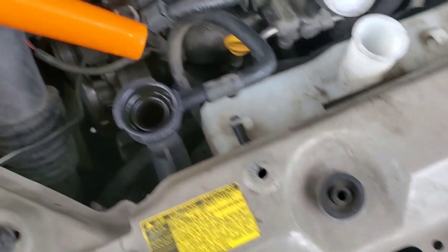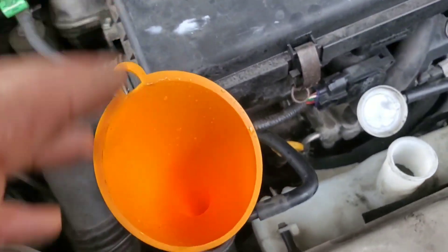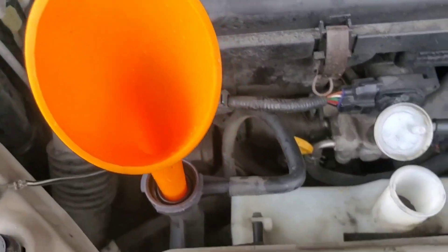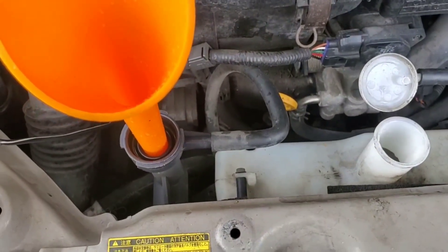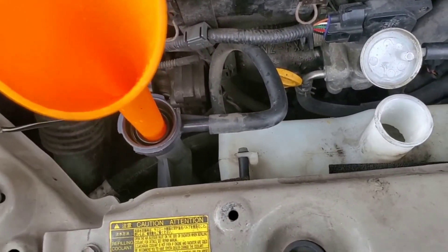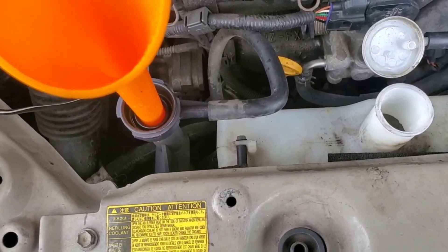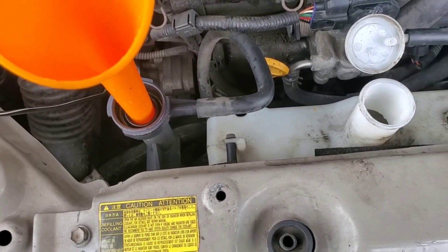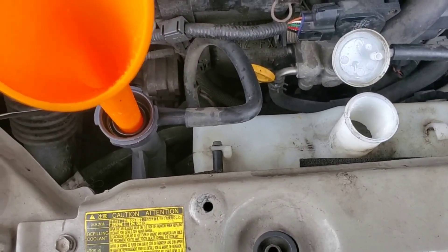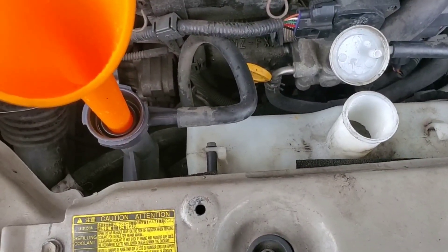If you find a larger funnel neck and jam that down in there, that gets more top pressure to help push those bubbles out. It's really not a tough job — the toughest part is getting all the air out. If you measure how much coolant you take out of the system, you can measure how much to put back in, whether you're reusing that coolant or using a new bottle. That's the best tips I can give you — appreciate it, see you.